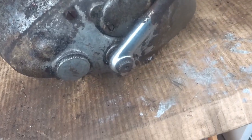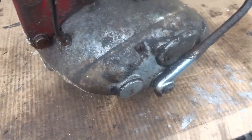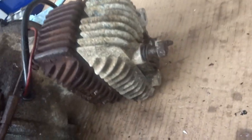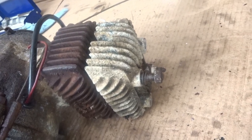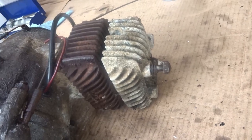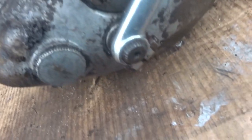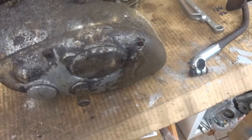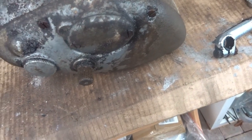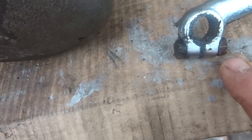The first thing I'm going to do is take off what looks like a kickstart. I had a severe job with the plug — it was really seized in, but I soaked it in petrol for two days and it came loose. I've just taken off the kick pedal; the spline on that looks good. This is an 11mm nut, so you'll need an 11mm spanner.